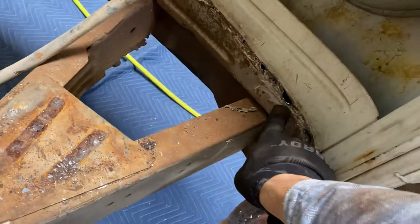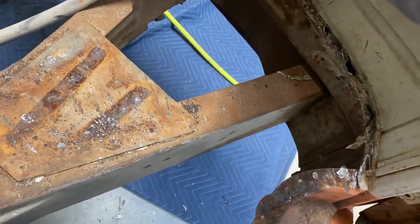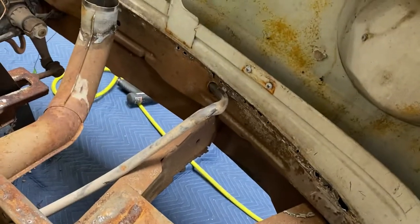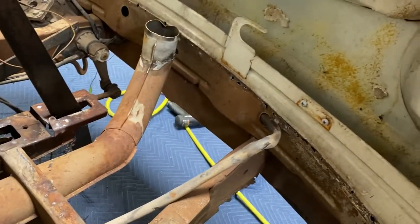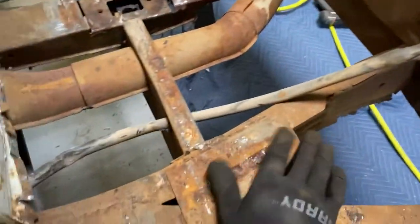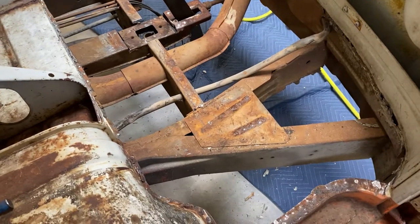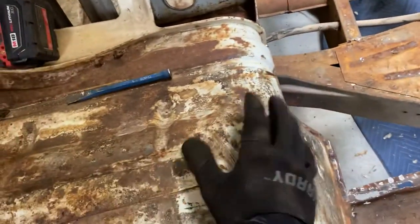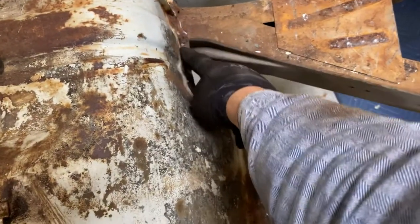There's the other side coming from the passenger door — you can see where I boogered it up right here, so I'll have to weld that stuff back up, but that's all part of the process. I have to polish all this stuff clean for when it comes time to weld in the new pan. Pretty simplistic on how this stuff attaches to the body — on the seats, wheel wells, and arches you have this interior lip.